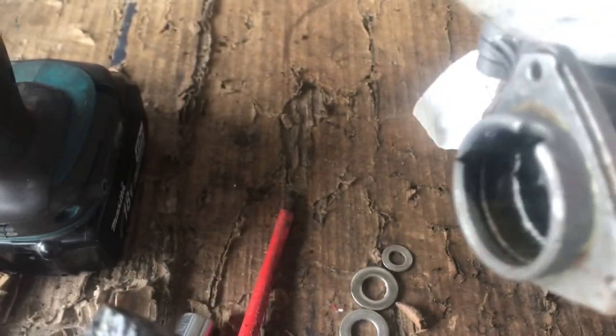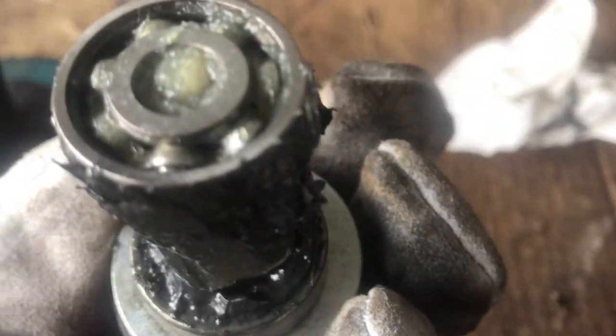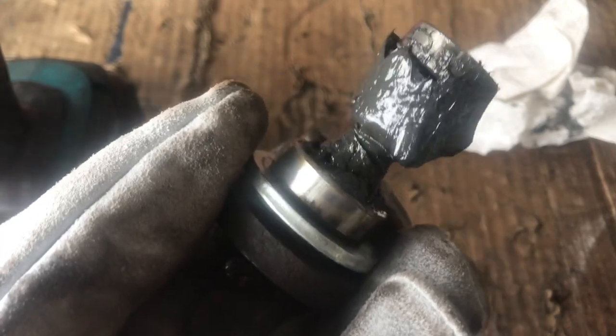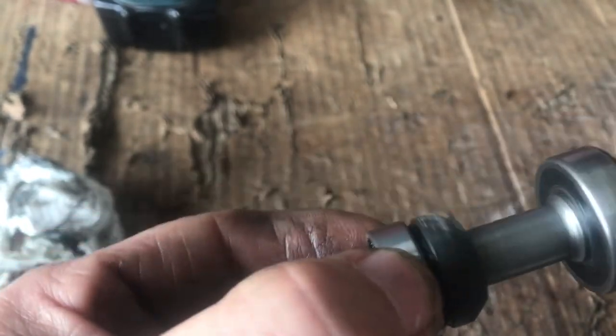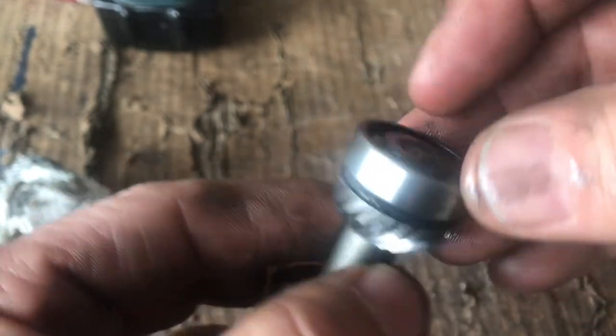So we've got that in there. We can clean this all up and put some new stuff in it. That's the bottom bearing — it's still got different colour grease on it. So I'm going to take that off, let this cool, clean it up. Right, I've cleaned that up. Actually that bearing is lovely — this rear one is beautiful, but they don't normally fail. This one's a bit rougher. This one's the one that normally goes. But I've noticed that's a sealed bearing, which is good quality. This is a beautiful bearing — this is an SKF, which is an expensive bearing.